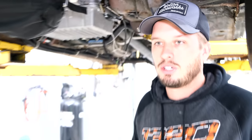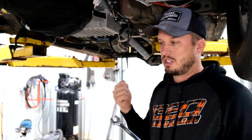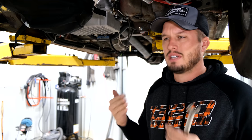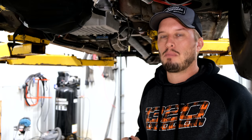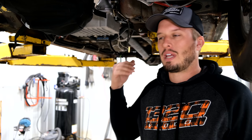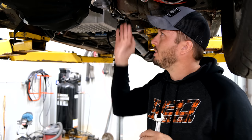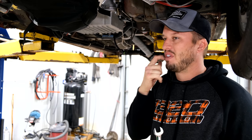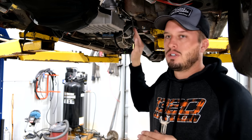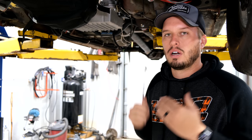Those are the three gears you want to make sure you have perfect. Park is usually two clicks or just a long travel — that one doesn't really depend on anything. And reverse is just not quite as important; you're not using reverse with high fluid demands moving down the road at fast speeds. As long as that ends up pretty close, you can check those last couple after everything else is verified. But if you're going to err on something, make sure low, high, and neutral — or first, second, third, and neutral — are exactly right.